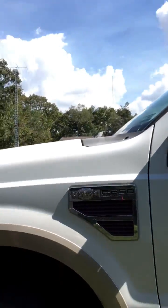Hey everybody, Ford F250 2008, probably through 2010, 6.4 King Ranch. This guy's been acting up on me a little bit. I get down below a quarter of a tank, somewhere close to an eighth of a tank, and it'll cut off on me before you ever hit 50 miles left to go. Figured most likely there's something going on with the fuel tank, so took this guy out.